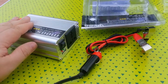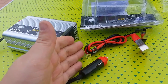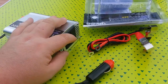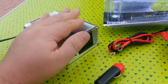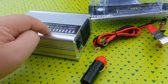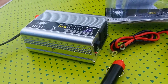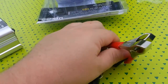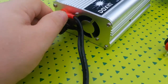I'm going to talk about my power inverter. It basically converts my 12 volt battery into 220 volts power, which is for my camera, my laptop, and other bits and pieces that aren't heavy users of power. You have to be sensible with it, which is why this is a 500 watt and not a 1500 watt. If I go down the route of solar panels later, I can swap the cigarette lighter adapter for the crocodile clips — you just swap these over on the end here.